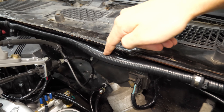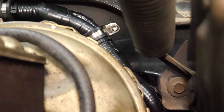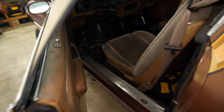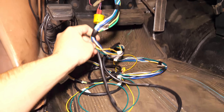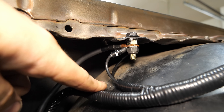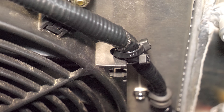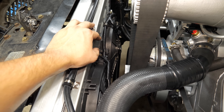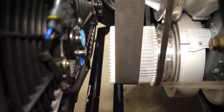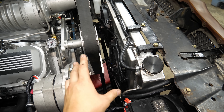Back to the main harness, it comes along the top of the firewall. My section of harness splits off here — the other side goes to the body harness and back through the bulkhead connector in the firewall, while my section comes down and goes through that grommet on the inside of the car, exiting the firewall right over where the fuse block is. I'm regretting not buying more wire colors, so these labels are very important. The ground for the fans is connected over here and kind of loops back around. I drilled a quarter-inch hole and that worked really well for zip-tying the wire. I would normally put this wire around the bottom to keep it out of sight, but that lower blower pulley comes so far out I didn't want to get in the way of it — that's the only way to get the belt on and off.